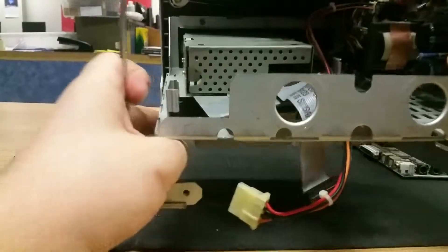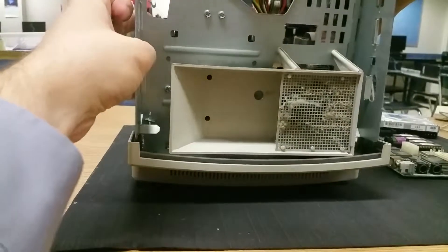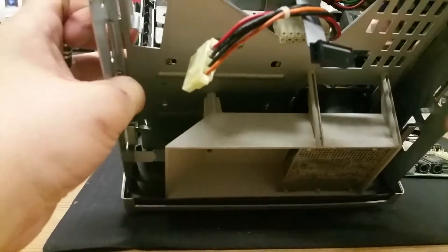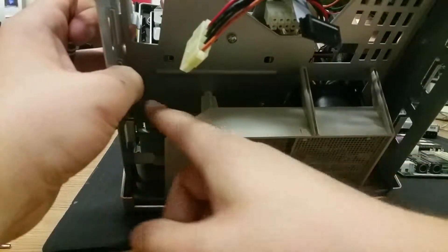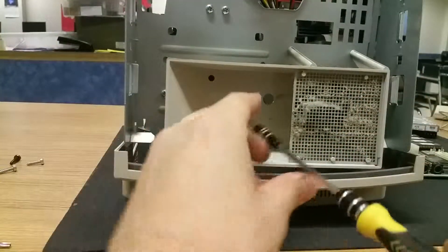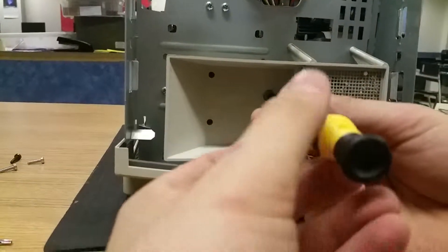The last piece that we're going to remove in this video is the floppy disk drive. We have a little plastic heat sink down here, and if we take a look we actually have a hidden screw back there. So we have four screws that we need to remove. Thankfully we have a nice screw hole right here that we should be able to sneak right in and grab the screw.